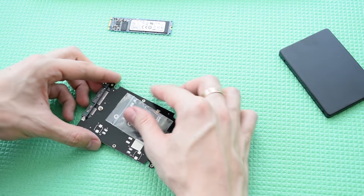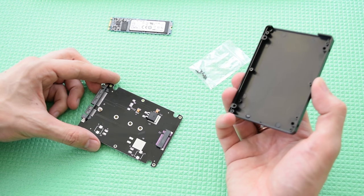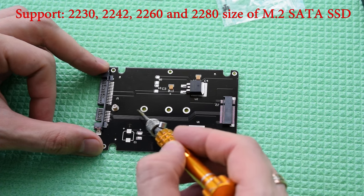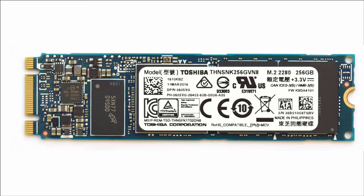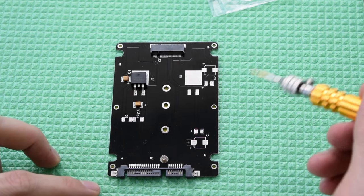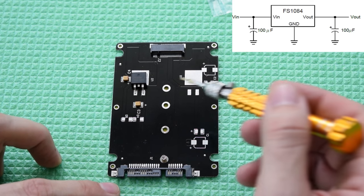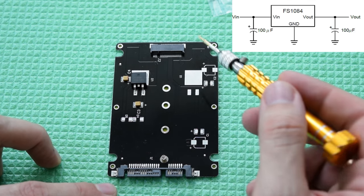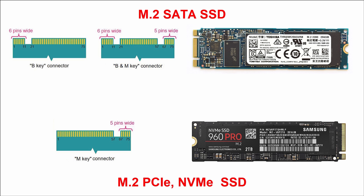Let's see what's inside — some teeny tiny screws for a cover. This adapter supports M.2 drives with different dimensions. My SSD is 2280, which means 22mm wide and 80mm long. It's a nicely made PCB with pretty simple schematics: filter caps and a 3.3V voltage regulator.